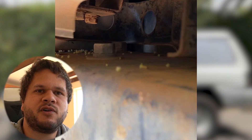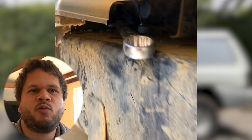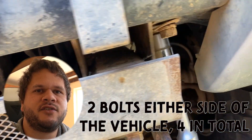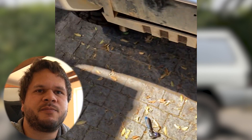There are also two bolts on either side of the vehicle that need to be removed — one on each side. Then we need to remove another two bolts underneath once that front grille is removed. Both of those bolts are removed on either side, and once that's done the bumper is then loose and ready to come off the vehicle.